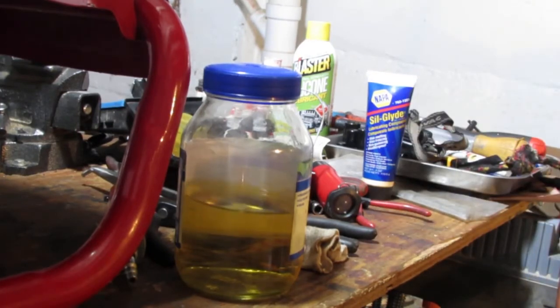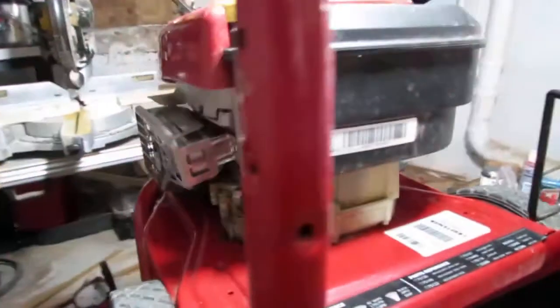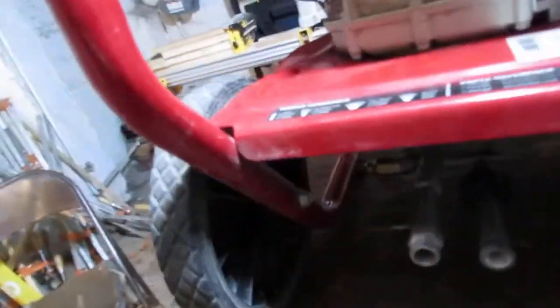Okay, so we had a couple, three actually, bolts. It's gonna be hard to get. That one, they're all 13 at the top, right? And here, and right back here. And underneath, those top ones are again 13. That one's gonna be the pain in the tuchus. Okay, so we have three of these, two, three that go into them, and they are 6mm hex.